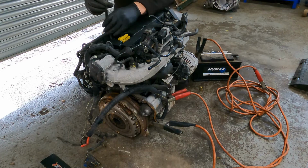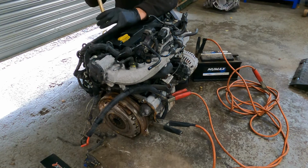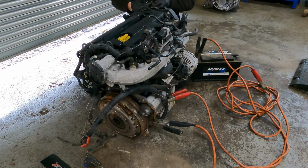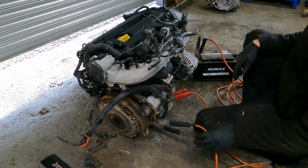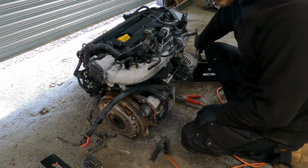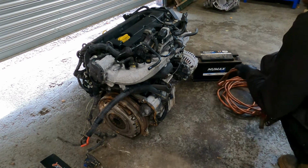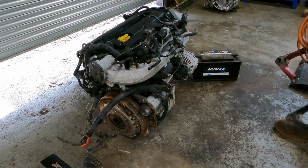Cylinder 4 is 200, which is the best one. Yeah, some of you are probably saying this is amazing because on these engines, it's always cylinder 4 that melts or goes pop. Although that's usually on engines where people have remapped them without doing any engine work. I've never actually seen one standard have that problem. But the people, they never tell you that bit, that they map them.